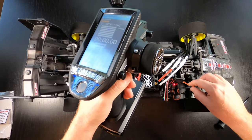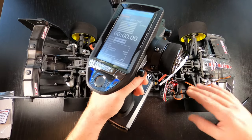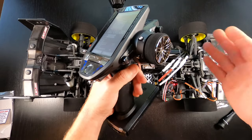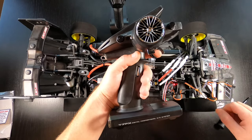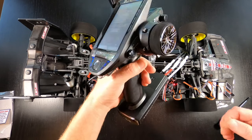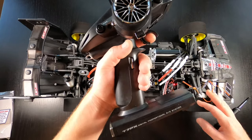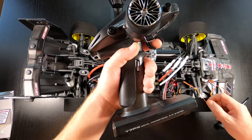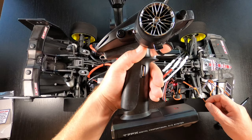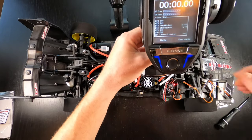Just a reminder — you can use Castle Link and Castle Quick Connect with Perfect Pass no problem. It will read everything and work just as it worked with stock configuration. So now we've recalibrated Perfect Pass. We can still enjoy the delay and everything, but we don't have full throttle protection anymore. So if you're using Perfect Pass for drag, this is how you cancel the initial full throttle protection so you can actually launch as fast as you can.